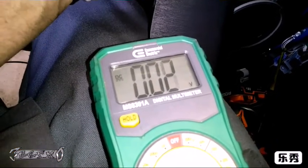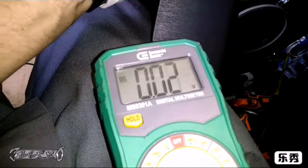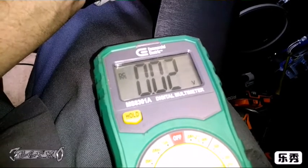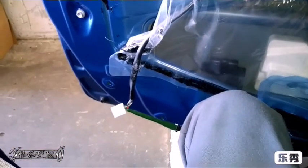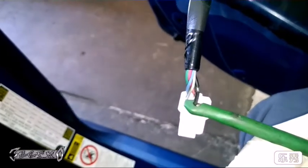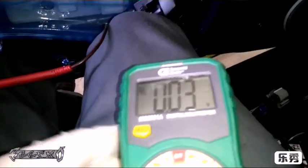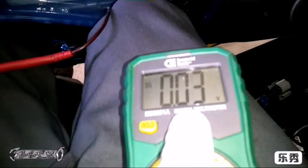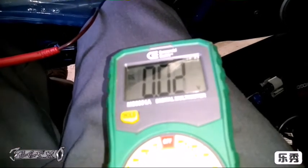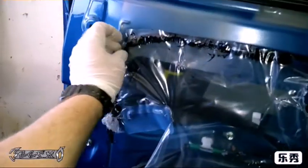It's reading eight volts but should be 13 - probably because my wires are moving around. You're basically checking for at least 8 to 13 volts. There it goes - 13 volts when I press the button. That tells me my switch is good and I've got power. Now let's check the ground. I'm tapped into the black wire and kept my ground on the same spot. This should read about 0.03 or 0.04, meaning the ground is good. A little resistance like that is normal. If it was like 3 volts, that would be a ground issue. So I know my actuator is bad.